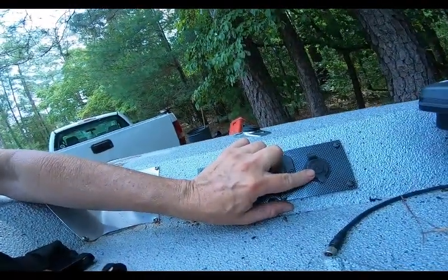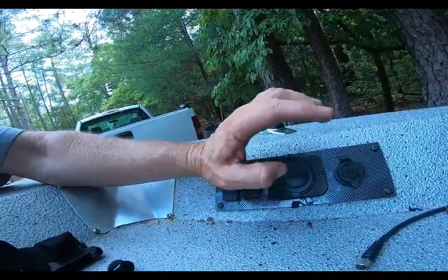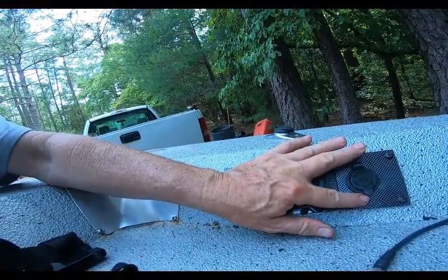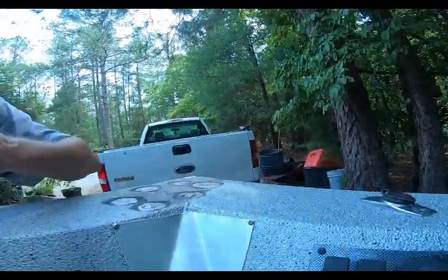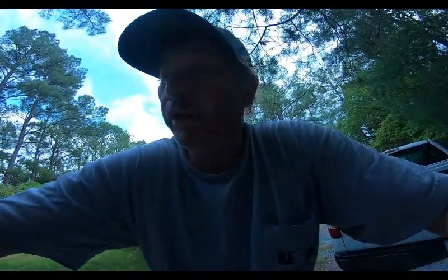Okay, now from this switch, what are we going to do? Are we just going to pull the wires out here? Okay, we're back again. It went click. I don't know what happened, but yes. So if that's live, current all the time, we'll put a switch in here. When the switch is off, no current to the lights. Switch is on, current to the lights. So what's the least invasive way that we can do this?